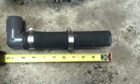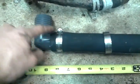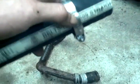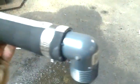This is what I got going so far. I cut 8.5 inches to duplicate this part. I pre-tightened this clamp, and I'm putting it facing inboard because I know there's no obstacles in that vicinity. And then this clamp, I'm gonna have it be on this way, so I can get right to it from the bottom when I get it in there. But I'm not going to tighten it because for rotating purposes, I'll just snug it, and then get yourself some white lithium grease. Makes things slide together a little bit easier.